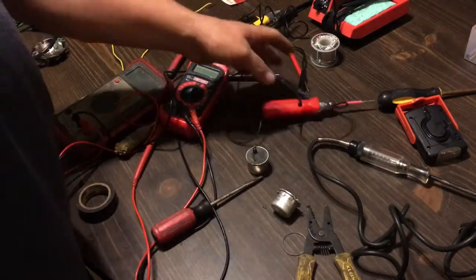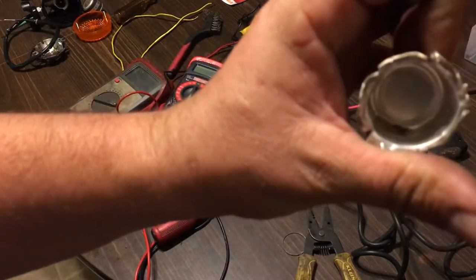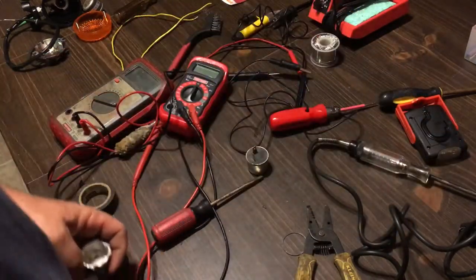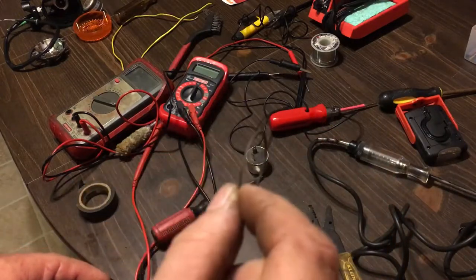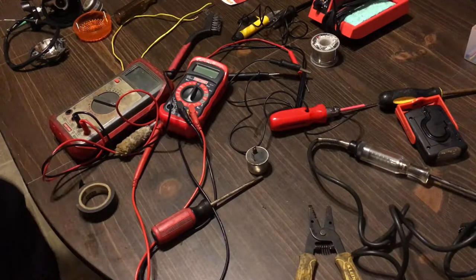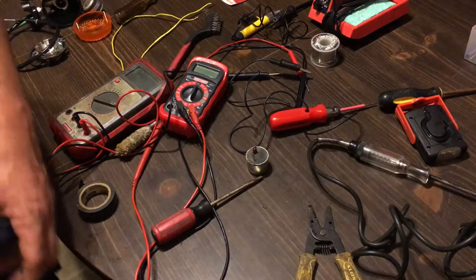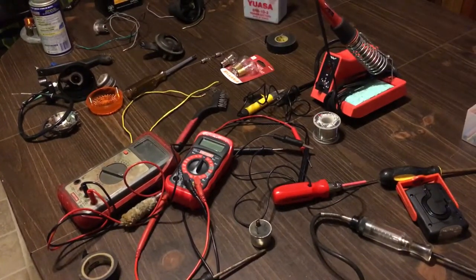So tonight I've shown you what's inside of a flasher. You can see the crud in there — these things really take a beating. Typically what happens is the seals fail, they dry up, moisture and water get in there and as you saw, it shorts them out. So to recap, we covered what battery fits the 12 volt system, what the light bulbs are for the marker light and brake light.